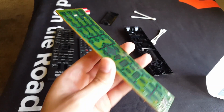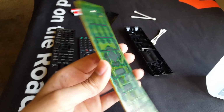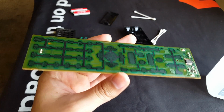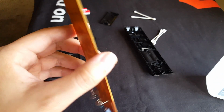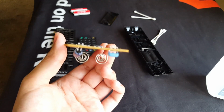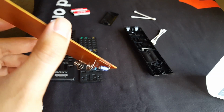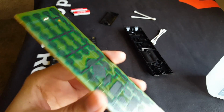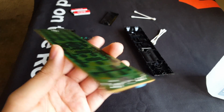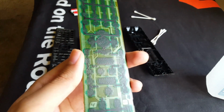So I just passed there. The good thing about rubbing alcohol, it just dries instantly. So this thing will be ready to rock and roll. One thing you want to check, if you're gonna do it yourself, also check the connectors, because sometimes the solder points disconnect themselves. We are more prone to drop these remotes more than ever. We also drop them behind the couch and stuff like that. So just check that all the solder points are connected. Make sure there's no battery acid in the back. If you have to, then you have to take out the soldering gun and complete the connections here.